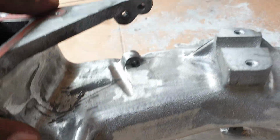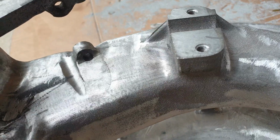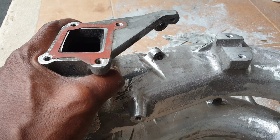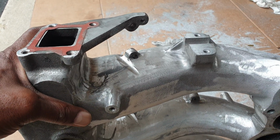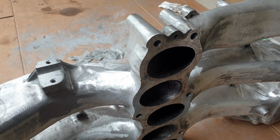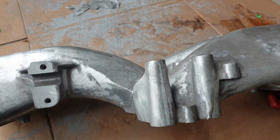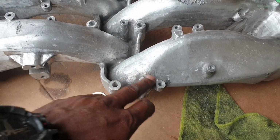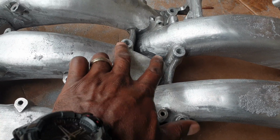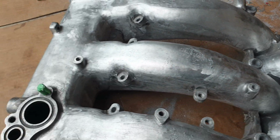And you're going to have to get these 2 bolts off right here. These 2 bolts are going to be very hard to reach at the back of the engine, but after you take off the hoses for the IACV, then it'll be a bit easier. It helps with our small hands. Again, my hands are not that big, so you can see that. At the top of the plenum, you're going to have these bolts, 1, 2, 3, 4. If I can keep the camera steady, and then here, and these two right there. And it just gives you an idea of what you've got to do.